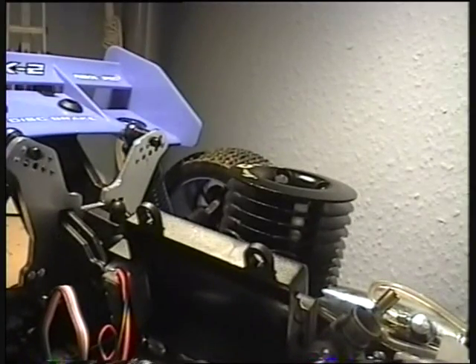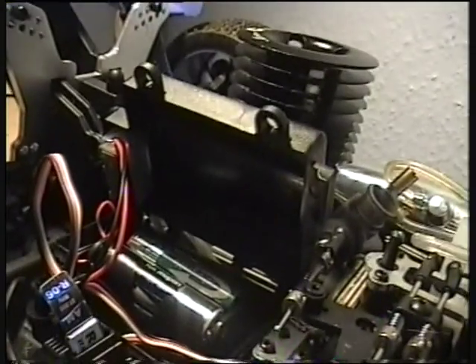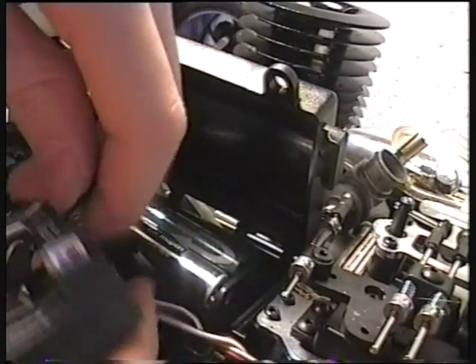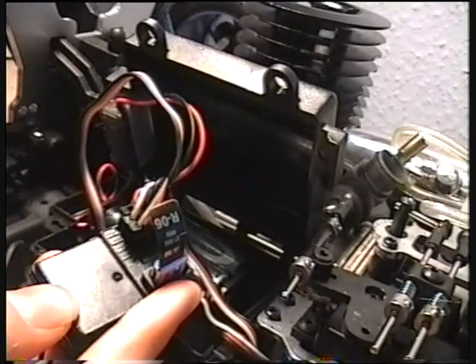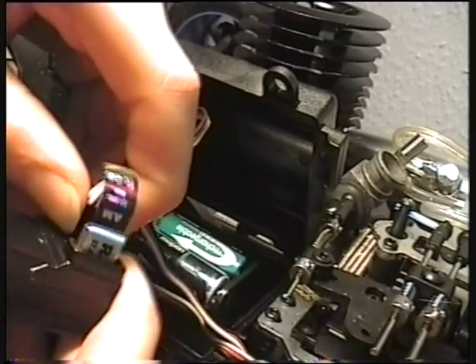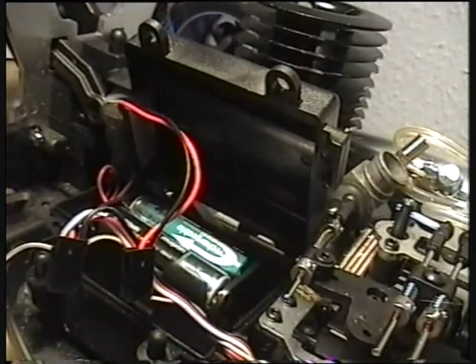What I'm going to do is I'm going to take this receiver out and I'm going to put in the new one. I'm going to show you the correct way to do that. So the first thing you're going to want to do — open your receiver pack, and you're going to see there's three little black connectors going into the receiver box. You're going to want to remove all of these. The receiver just comes out like that.